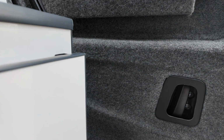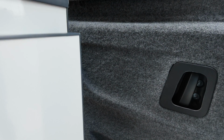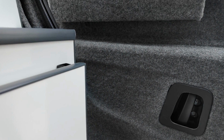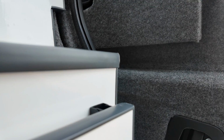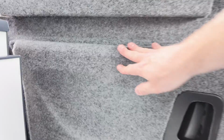one cable. In the van, you'll see one cable, and it goes from down here up to here. On the other side of the door is the door handle, and as you pull the handle, it's a bit like a bicycle brake cable. You've got an outer and an inner, and it pulls the inner and releases the door catch, which is down there. What you need to do is take that completely out of the van, so from inside you can release the cable from the back of the outside door handle, and that needs a little bit of patience, but it's perfectly doable.